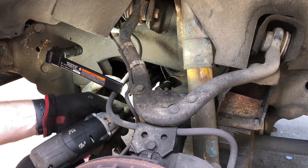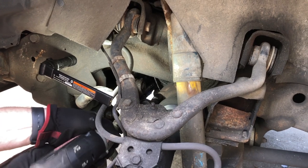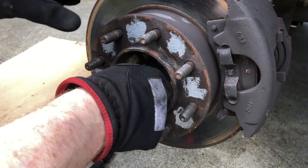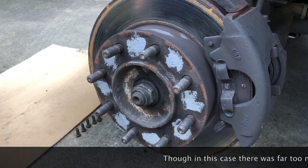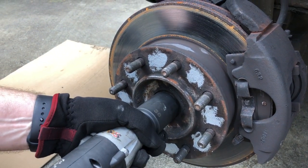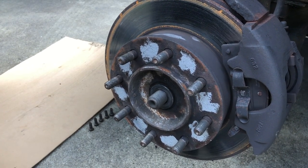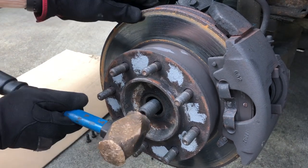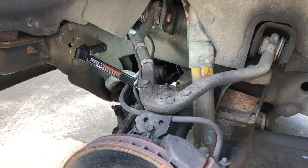We got the last one up here. This one I'm not actually going to remove — I'm just going to loosen it up. Then what I'm going to do is take this axle nut off. I like to do the axle nut after so that we can shake loose the corrosion that might be holding that back piece on. We're going to take it off with a 36mm socket.